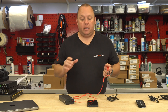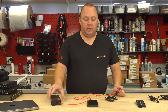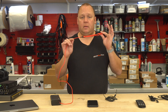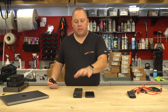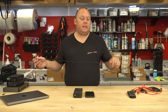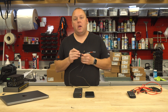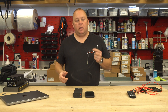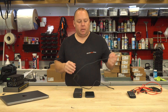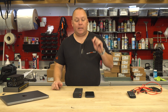Honestly, when I need to quick charge I use the dedicated cable. But the vast majority of the time — like when I'm going to bed or leaving my device on the side of the table — I really just want to plug them all in and not think about it for a while and come back and have them all be charged. That's where this cable really comes in handy. Going back to the battery, it comes with a USB-C to USB-C cable, just a little over one meter — almost close to four feet long — and this supports 100 watts of power delivery.